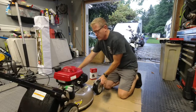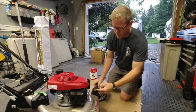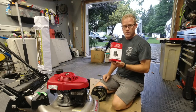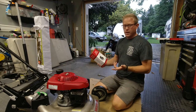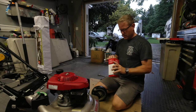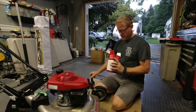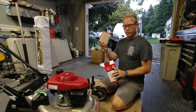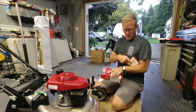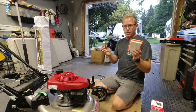First, the lawnmower has a spark plug. Honda puts together a pretty awesome kit that has all the things you need. You need about 12 to 13 ounces of oil and they give you exactly that inside this kit. Inside the kit you have oil, an air filter, and a spark plug — all three are something that anyone at home can do, super easy.